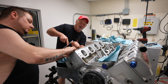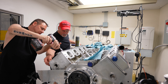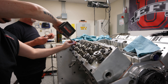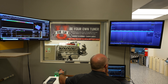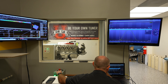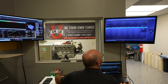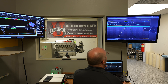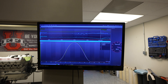Putting the head back on, going to try some new valve springs, going to lighten up on it and see what happens. That's so much better. Just watching it, it looks amazing — a million times better. No bounce at all. Look at the valve lift — it doesn't move at all now. We still have loss from the deflection, but we literally cut it in half. It was losing 12 degrees before; now it's 284 to the worst is 277. It's beautiful — look how smooth it is.